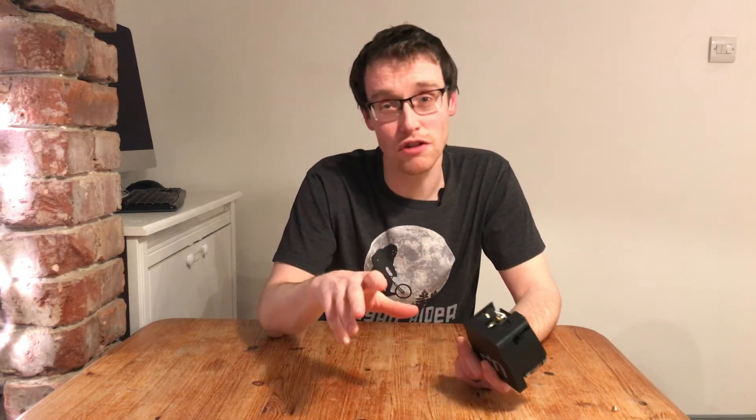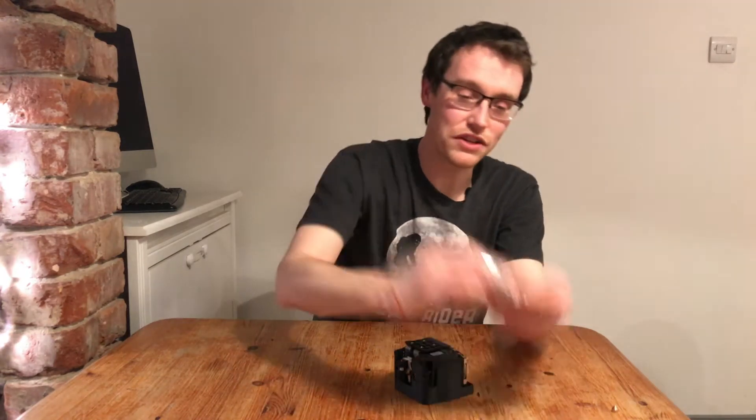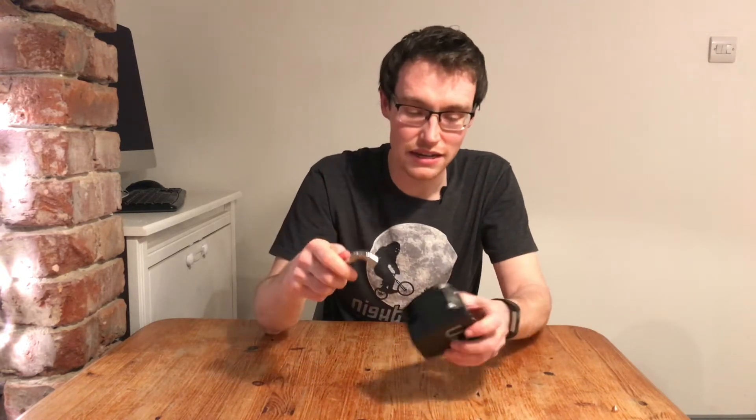After that we're getting into the realms of black magic, and the next two things are what you really hope to avoid. Before stripping down the whole head, check the software — have you recently changed your slicer? Is the g-code being created in a weird way that isn't outputting extruder code? Probably not going to happen, but do check it. The final thing is the nozzle itself. On the Upmini 2, they include a little kit with a wrench. If it comes to it, you'll have to soak the nozzle in acetone, probably burn it on the gas hob, and try to rod it out with wire. Not difficult, but time-consuming — a real pain.